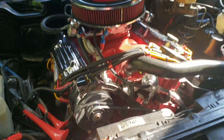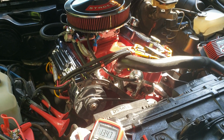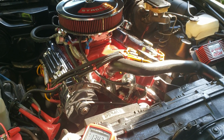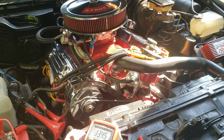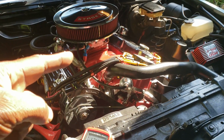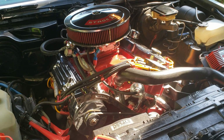That's it. Hopefully my next video, one of the 3 next newer videos, will be with this car finally at the track. Because right now, as is, fuel pressure does not drop under acceleration since I wired the fuel pump directly to the battery, as opposed to into the factory fuse box of the Regal.